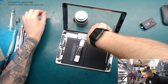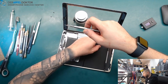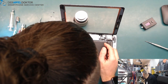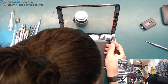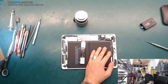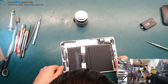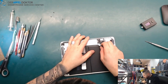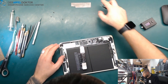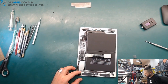We disconnect the battery — that's important. Then we get out the screws: one, two, and three. After that we take out the screen, then the touch ID and the touch screen. Now we take out the shield and here we have the TriStar IC.